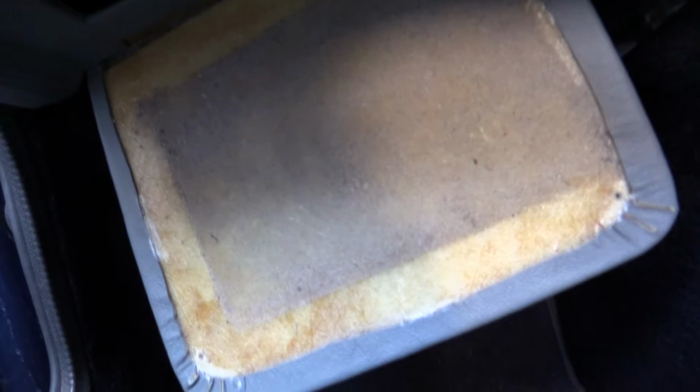First thing to do is to take what TVR laughingly call the glove box off the Chim. You need to undo these screws, one each side. They've usually got little white plastic caps on, and then this will flap down and there's an access hatch behind here, so we'll undo that first. Okay, so the flap's now hanging down. You can see there's access to all the joys under there.